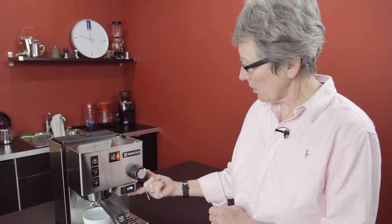So there you go — that's what a PID is all about. It's a pretty good feature on a single boiler machine because it controls things. Your shots are going to taste better because your temperature is going to be controlled to within one degree of whatever you ask it. Different coffees like different temperatures, and that's why it allows you to play with that. These controllers are used for other applications as well — they're not just made for espresso machines, but that's where we use and install it.